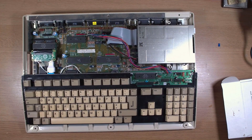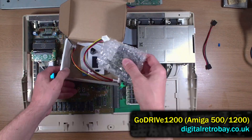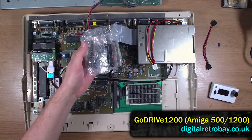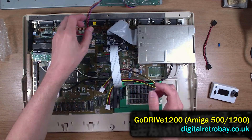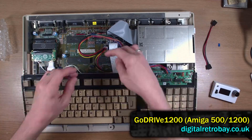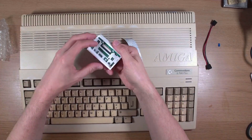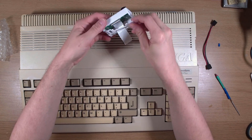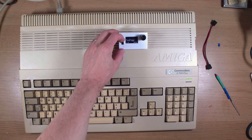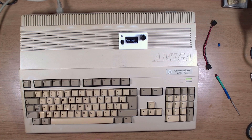Whilst modding stuff, I've decided to add another device to my Amiga. Now most of you will be aware of the GoTek drive, and I've never installed one because I didn't want to have to remove the internal floppy drive, and I didn't feel like an external one was the right option either. However, I've recently discovered an alternative — it's called the Go Drive by Digital Retro Bay — not a sponsor — and I've purchased two: one for my Amiga 1200 and one for this Amiga 500+. What makes this device so special is you can leave the floppy drive inside the Amiga and still use it. The board plugs over the top of the floppy drive connector, and you can connect the floppy drive to it. You then run a flat ribbon cable out of the case through the vents to a controller that clips on the top, so no modding of the case is required. This works like a normal GoTek and runs the flash floppy firmware. The smart thing about the Go Drive is that you can use a switch to hot swap between the real physical drive and the GoTek drive — perfect for someone like me that likes keeping the original floppy drive intact while still adding the convenience of a GoTek.